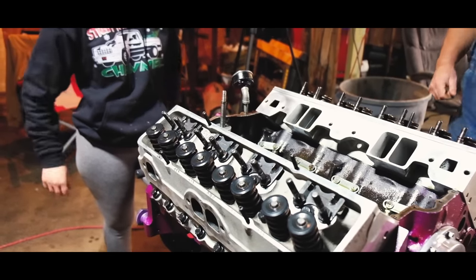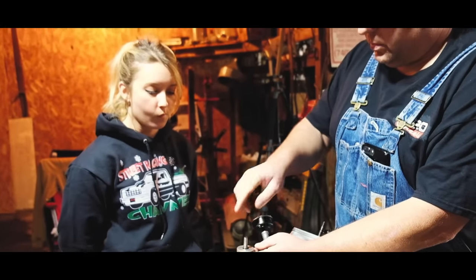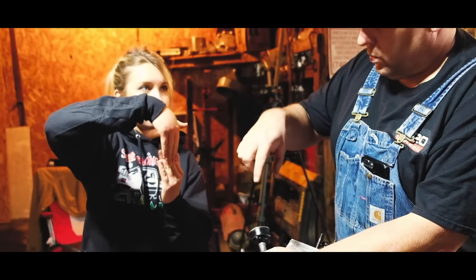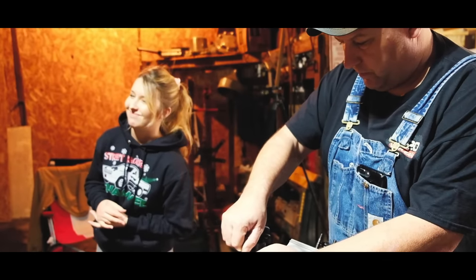So that's why when you guys bump it, like that, you bump it, and then it falls in. That's exactly right. That's why I tell Billy to bump it, line it up. Once that distributor lines up with the oil pump shaft, it drops in all the way. And then you know it's in all the way. That makes sense.